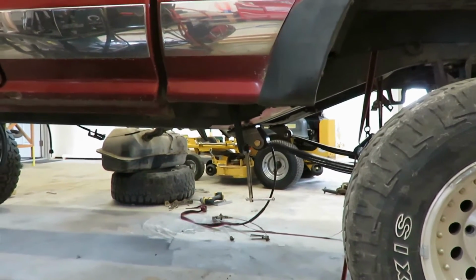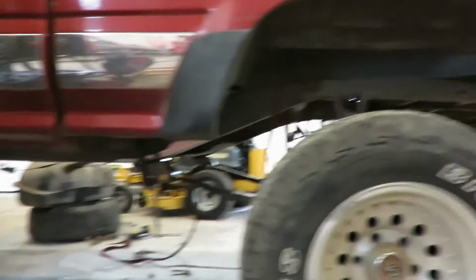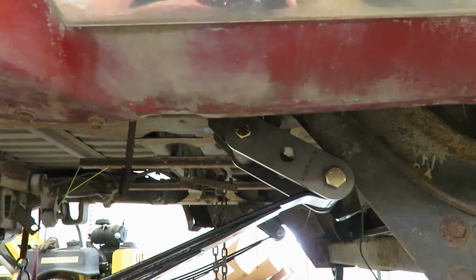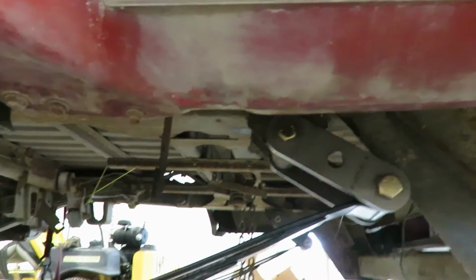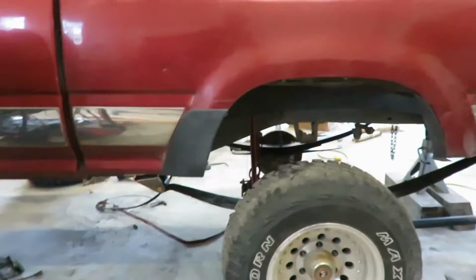Cut the tacks off, move those front hangers a ½ inch forward, and obviously those shackle hangers are not going to work. I got new ones already, so I got to cut those ones off and move them back. So I got to get that figured out too.